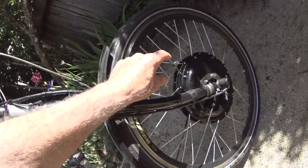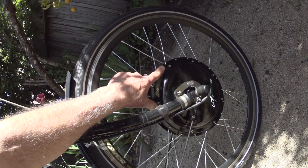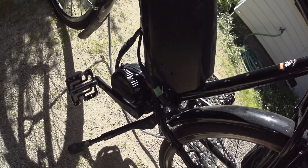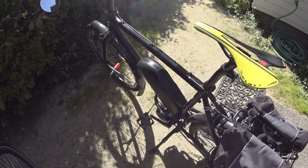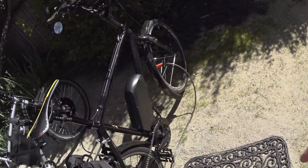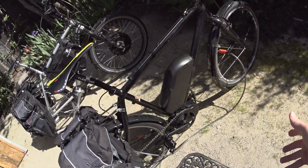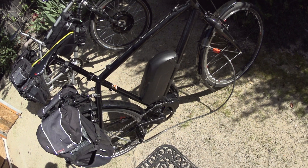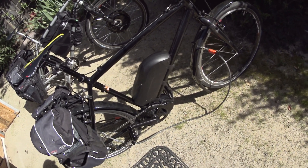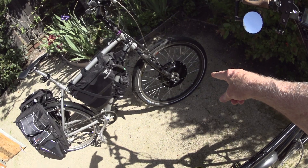But if I only had one bike I would probably go with the BBSHD because it would be powerful enough to pull my trailer. These hub drive motors are direct drive — there's no gearing inside, it's all driven magnetically, which makes them pretty reliable. The Bafang motors and the smaller hub drive motors all have nylon gearing inside, so if you get into a really steep situation or pull a big load you can burn them out — I've heard stories of those nylon gears stripping. I feel fine riding the mid-drive for commuting with plenty of power up big hills, but I would not want to carry a huge load because of the risk of stripping those nylon gears. That does not happen with these direct drive motors because there's no gears to strip.